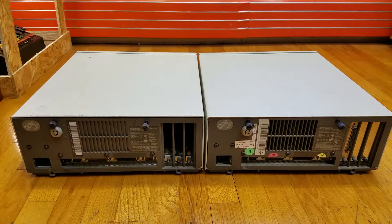When we open them up, you can see the inside and see where the fan is on the Model 70. This Model 50 was introduced in 1987 as one of the original IBM PS2 models. It has an 80286 processor and one megabyte of RAM. The Model 70 was introduced in 1988 as basically a desktop equivalent of the tower Model 80. It has a 386 processor running at 20 megahertz, and it came with 2 megabytes of RAM — this particular one has 4 megabytes installed. The Model 50 processor ran at 10 megahertz, so the Model 70 processor is twice as fast.